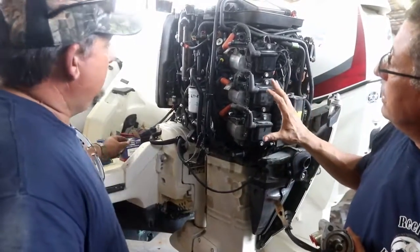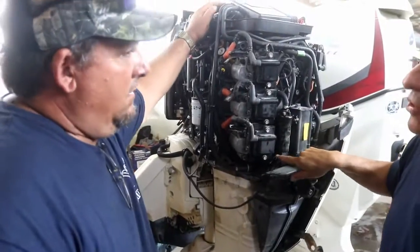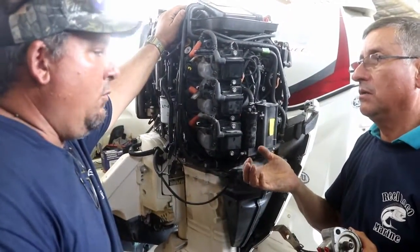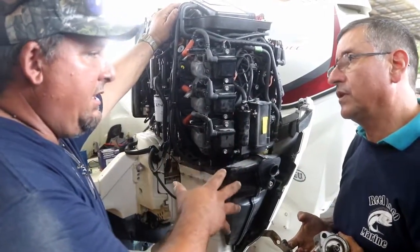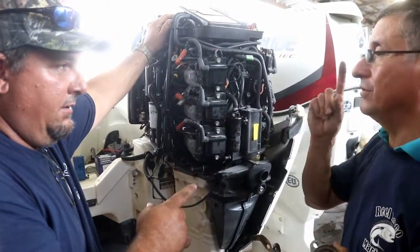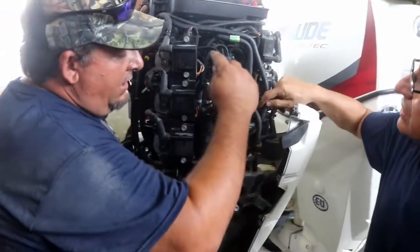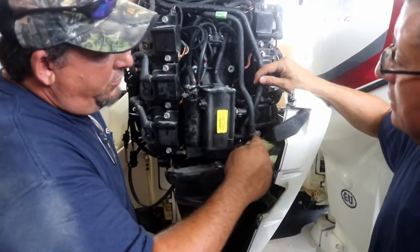Any other recommendation for the fuel system? What is the procedure? You check the high pressure over there, the low pressure with the same gauge. Not the exact same gauge, but another gauge, and it'll be very similar. But also, this one has a return line. The return line is actually on this side. So the fuel that it doesn't use, it brings back in.